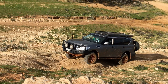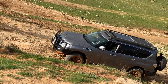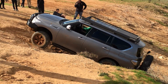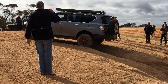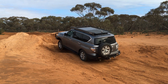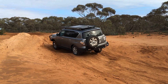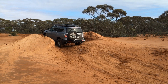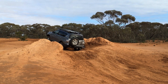Because of the momentum, I keep going forward, and this is so important for independent suspension trucks. This is how not to do it — this is my old suspension, Ironman suspension after 30,000 Ks. It just wasn't fit for purpose; it wasn't designed for the weight I put on the vehicle. You can see I didn't keep momentum — I was starting to see-saw, and that's what happens if you don't keep that constant momentum going.